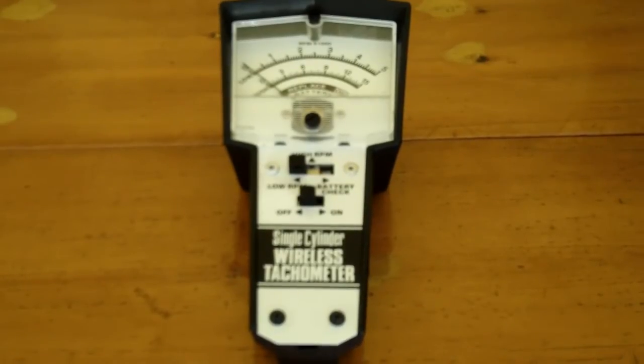When I was taking a small engine course a long time ago, they recommended that the blade tip speeds not exceed 19,000 feet per minute. That equates on a 20-inch lawn mower to 3,400 RPMs, and on a 22-inch lawn mower to 3,100 RPMs.